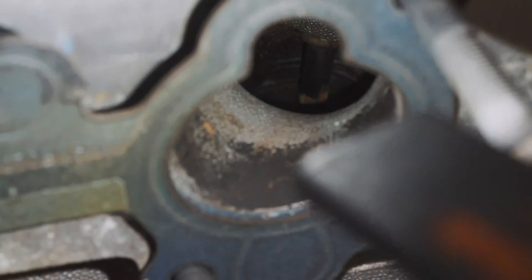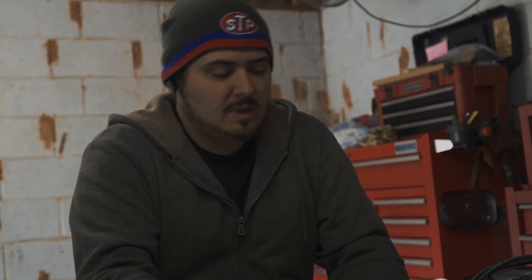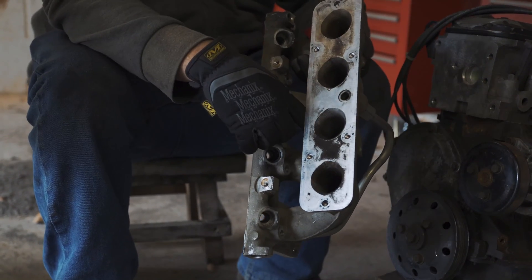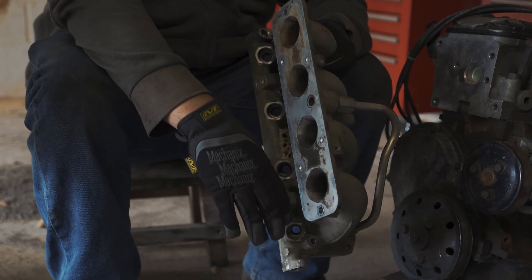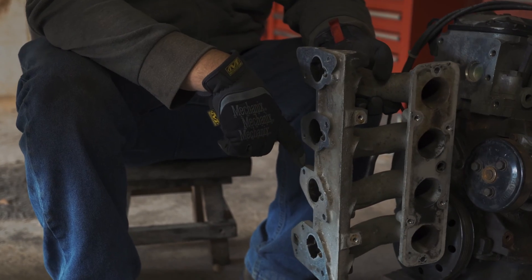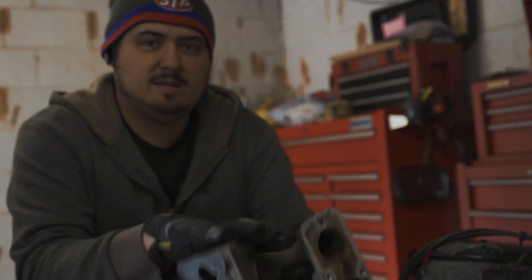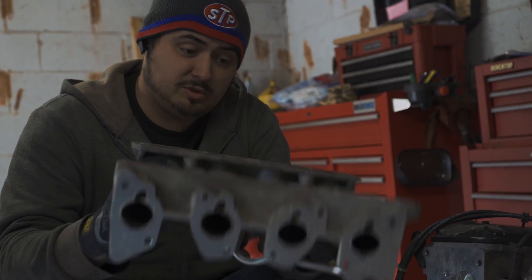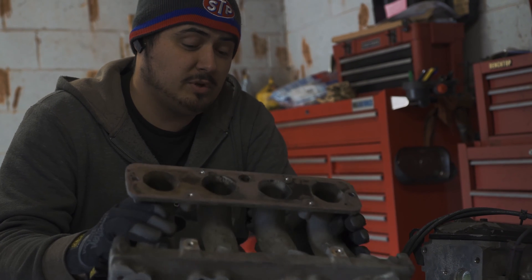In order to do that, our fuel is going to come in through our fuel injection system, which is going to be on the intake side of the engine. I've taken the intake off already to show you how this works. Air comes in through the top of the intake — this is what normally goes over to your air filter — comes in through these little intake runners and goes into these ports, these big open holes. The fuel injectors go in there and spray it directly into the engine through these little holes on the inside of the intake. So that's how fuel gets in — that's the fuel and air in FACTS right there.